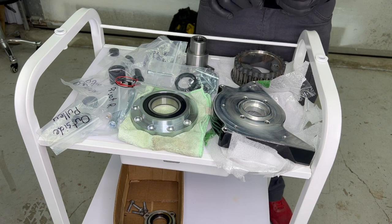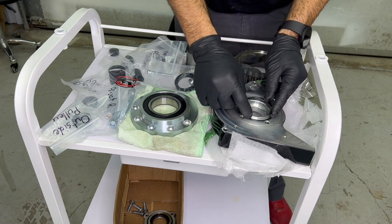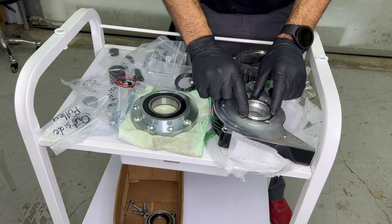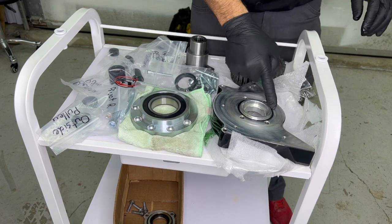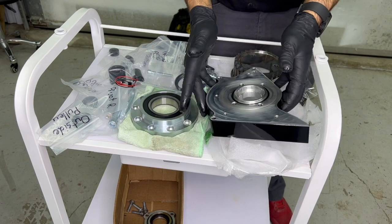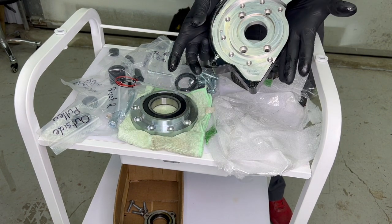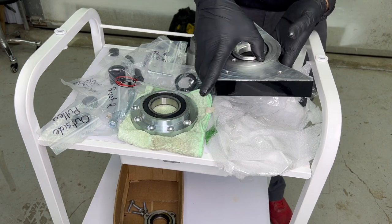Okay, so have a little cup of oil next to you and apply oil with your fingers to the seal and put the seal inside your offset kit just like this. Once you've installed your seal, pass your finger around it. Make sure that your seal is sitting flush with your offset kit.